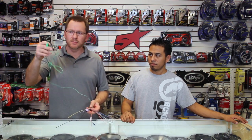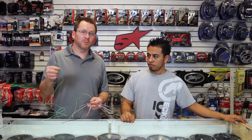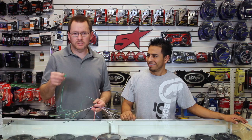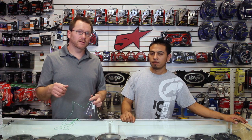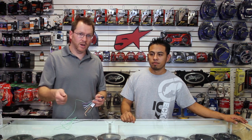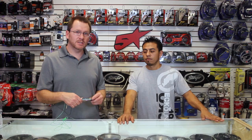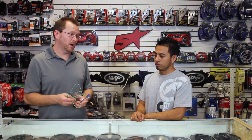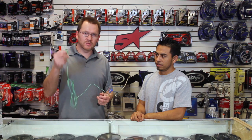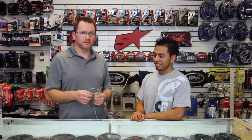And then you have the famed light green wire — this is the emergency brake, or parking brake, wire. This is the pain-in-the-butt wire. It needs to be grounded and then reset. On the new radios we found that if you go through the sequence — once the radio is on: brake, release, brake again, tap, release, tap — the radio will actually remember the sequence until the battery is disconnected. So if you don't feel like buying one of those bypass modules — and they're only about $15 — you could just leave this wire hanging, hook it up to a toggle switch. It'll remember the sequence until the battery is disconnected, then you have to do it again. We prefer just putting the bypass module in so we don't ever have to deal with it again.